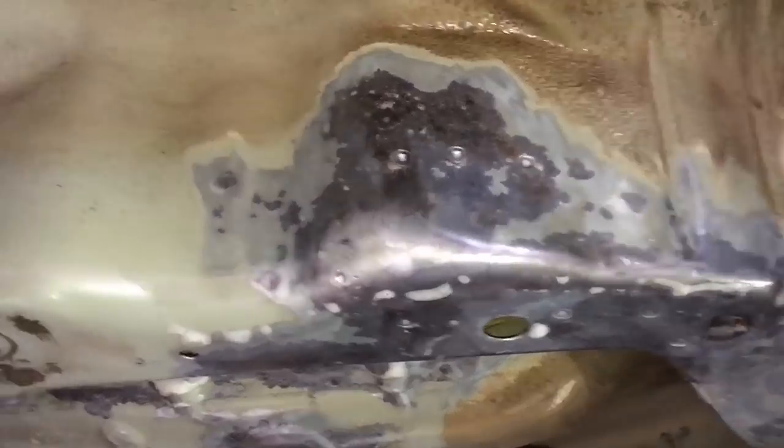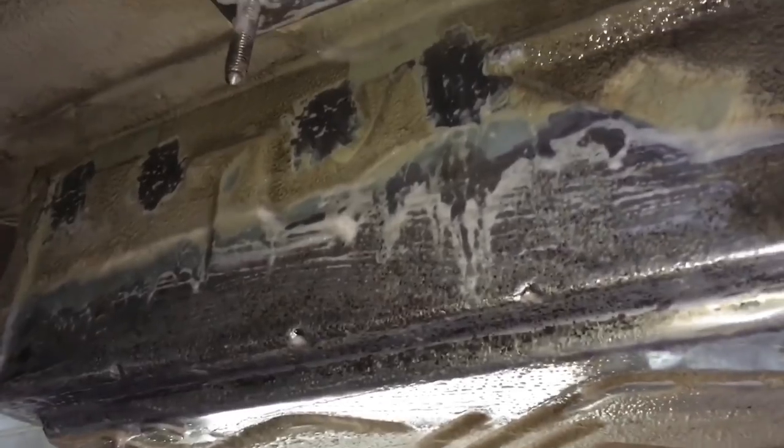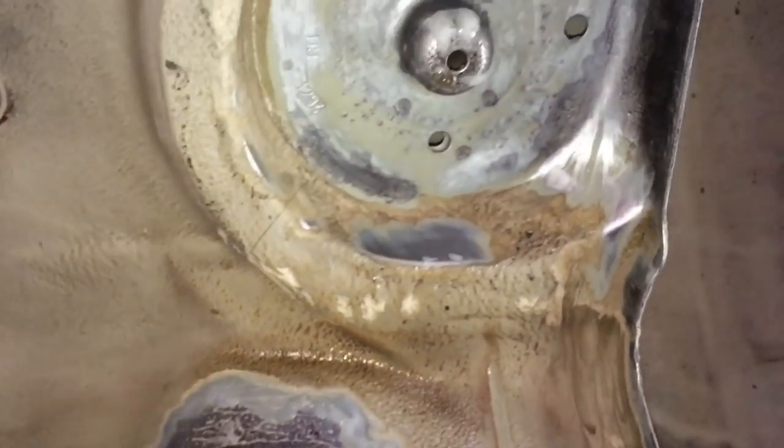Now everything's bare metal underneath, brackets are off, and the loose corrosion has been removed. Now it's time to treat that, so I'm using a Por-15 product called Metal Prep which just brushes on to the bare metal — you have to keep that moist for 30 minutes, just keep going around the car. I'm doing every bare metal point I've done, so I've basically taken care of the corrosion first before doing the crack work on this car. We're trying to neutralize the corrosion and make sure we don't come across any great problems or holes. Luckily we haven't so far — a few things are thin like the battery tray but we are saving it.